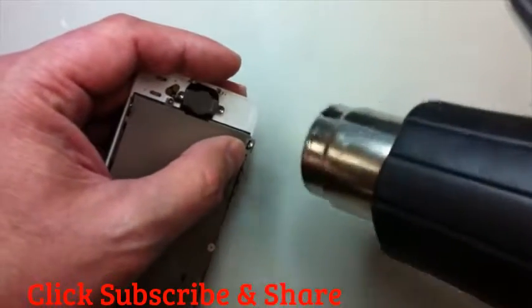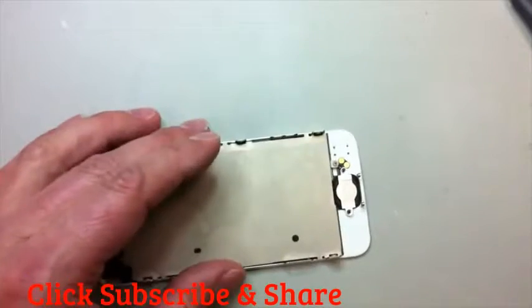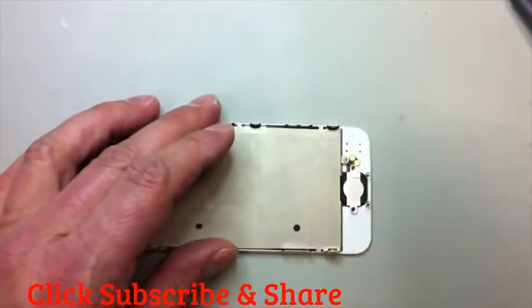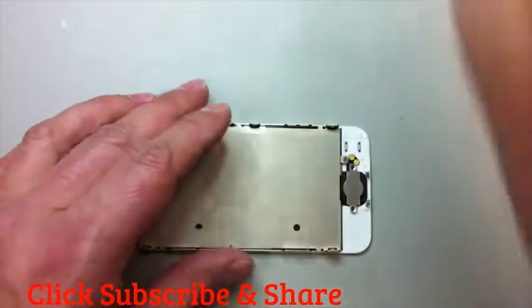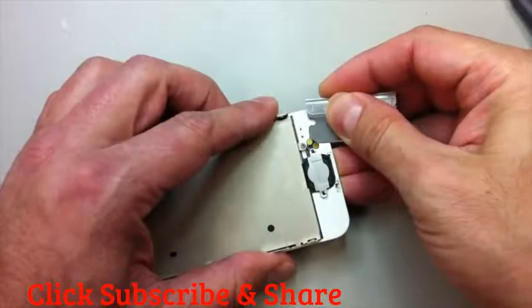So I like to put a little bit of heat on here. You'll also notice that my home button comes out relatively easy. That's because it has been removed before. You may have to use additional heat, and be very careful when you pull the button out, because you don't want to ruin that rubber gasket that's underneath it.